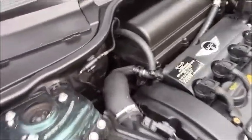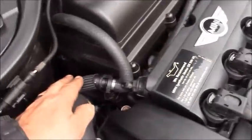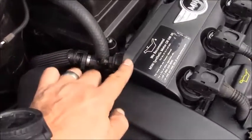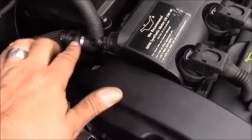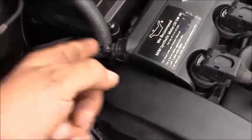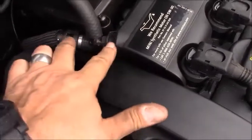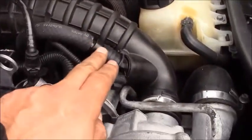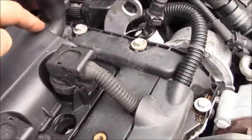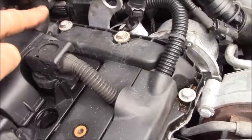And hey, just to clarify, so this hose here used to run directly into the engine here. So we separated it here, installed an adapter on this side, installed an adapter on this side, and those are your two main connections. And then, as Tracy pointed out before, over here, there used to be a tube that ran from here, from the turbo inlet, over to the engine here. This piece of hose was that original hose.